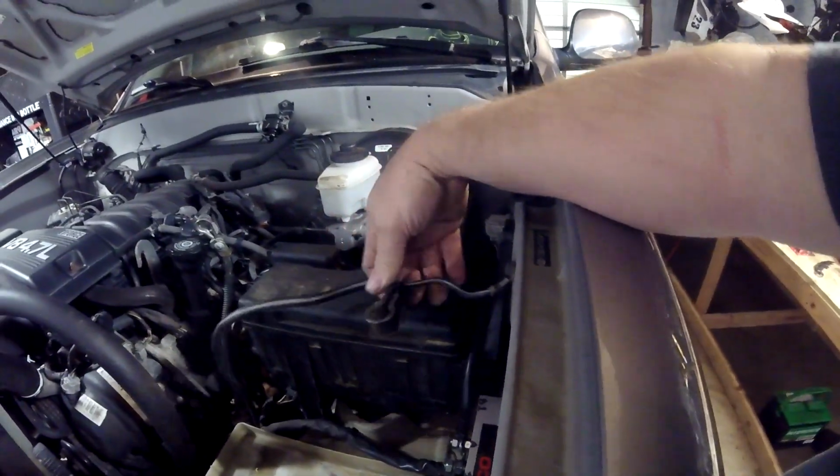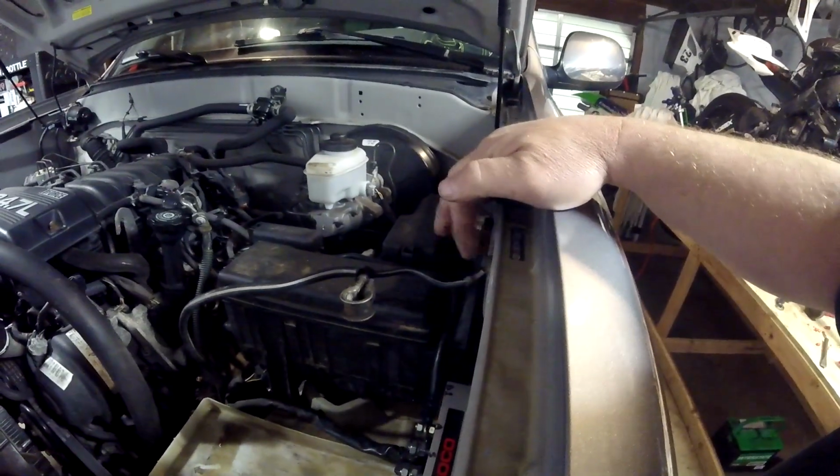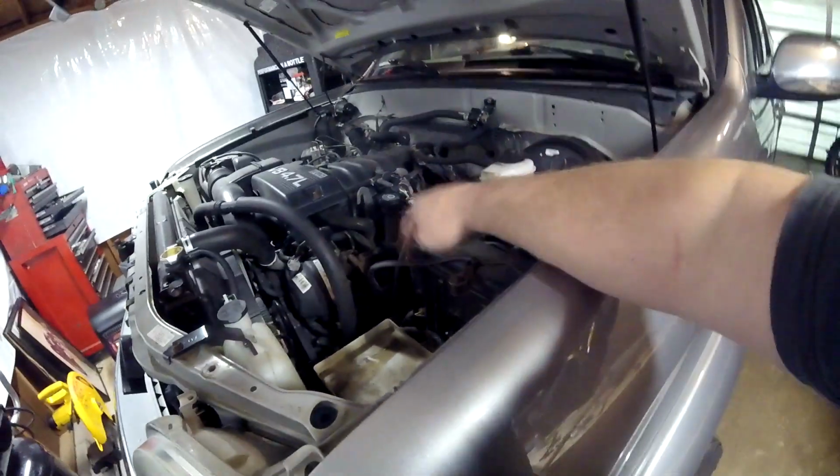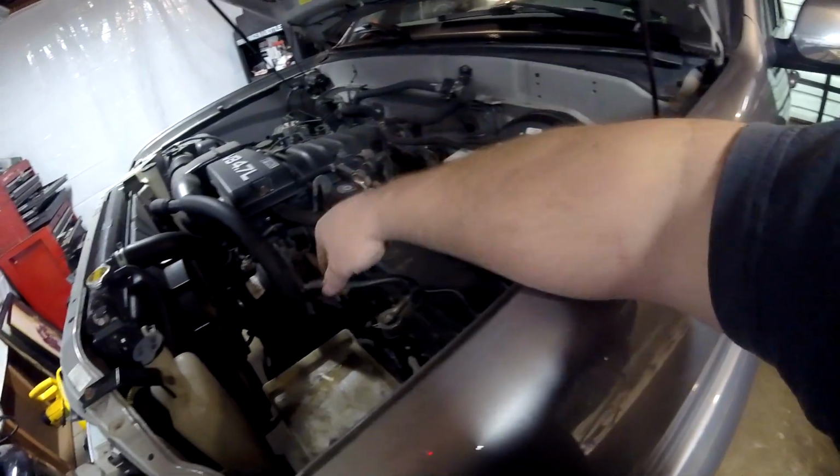And look at this, this is proof positive engineering-wise of what I'm saying. This is the ground that Toyota built. Look how big it is to the chassis, and look how big it is going down to the engine block, because that's where the starter load goes through. The ground from the body is next to nothing. The ground to the starter is huge.